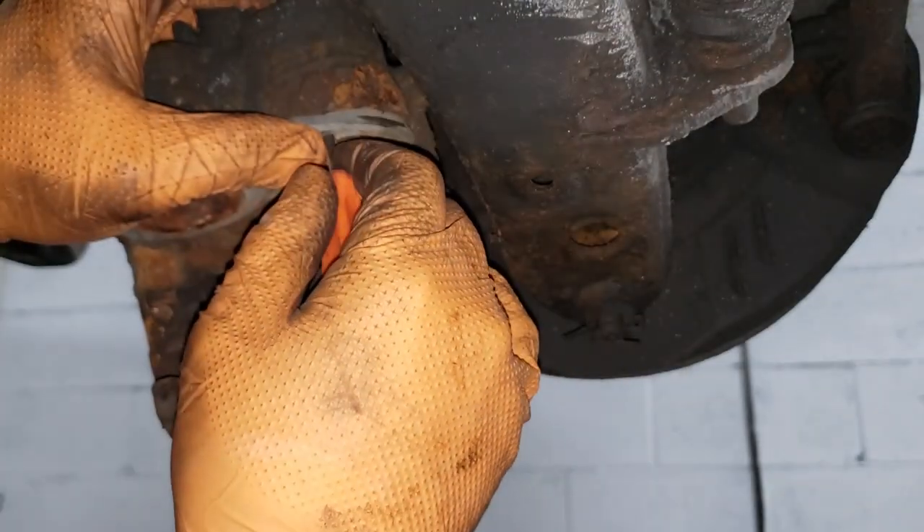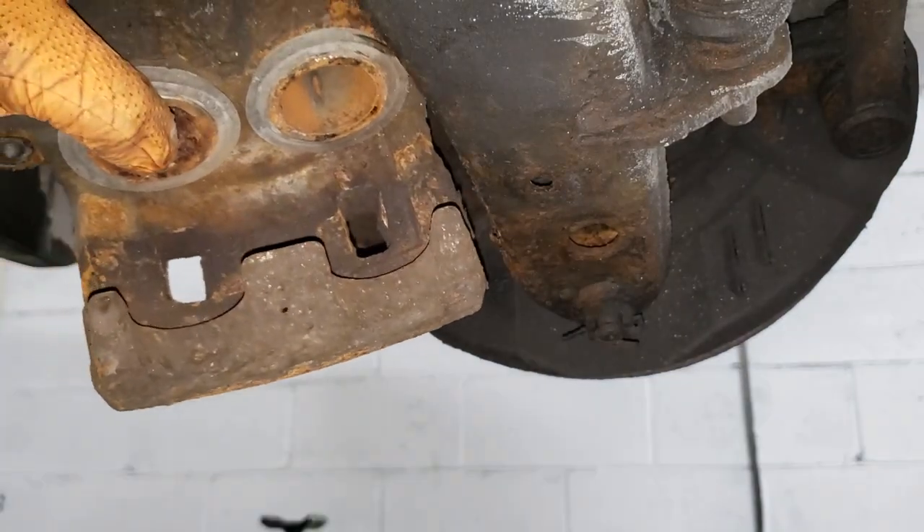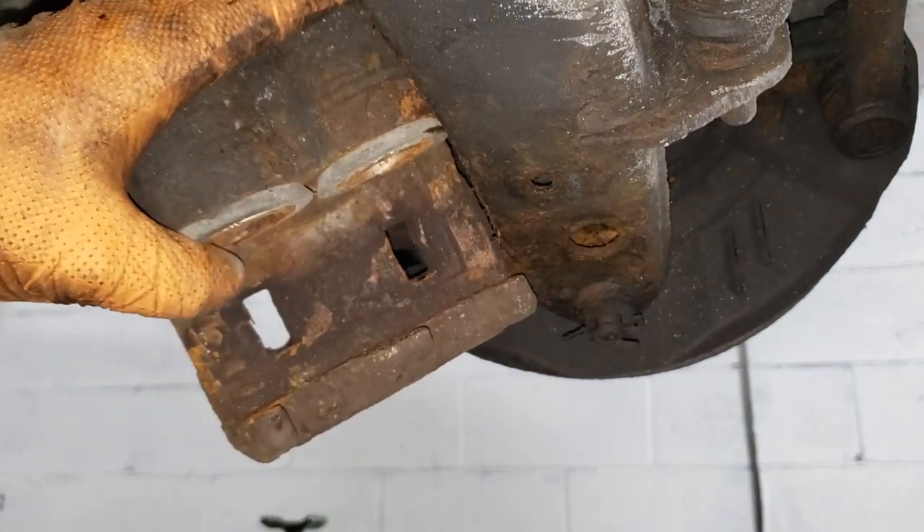C-clamps off. You can see here we've got a bit of bulge from our seals — that's a good indication they're still working. What you're going to do is take a flat screwdriver and just sneak it in between the seal and the piston, pulling the seal away from the piston. That guy's nice and flat and will not come into contact with our pad. Just get the air out — be very gentle, you don't want to screw the seal up. That there is what we're looking for.